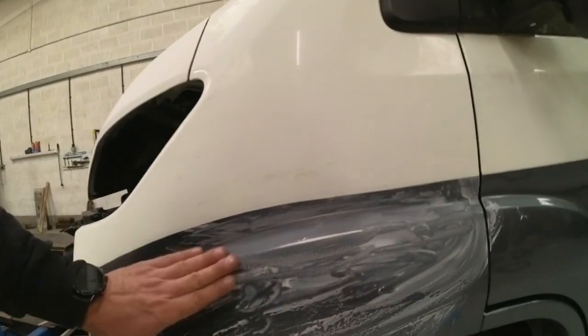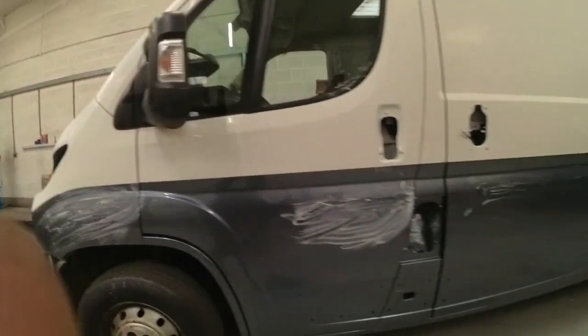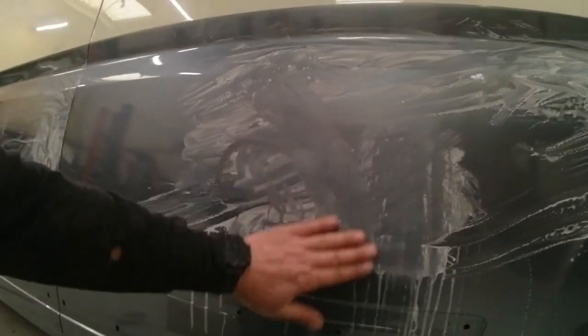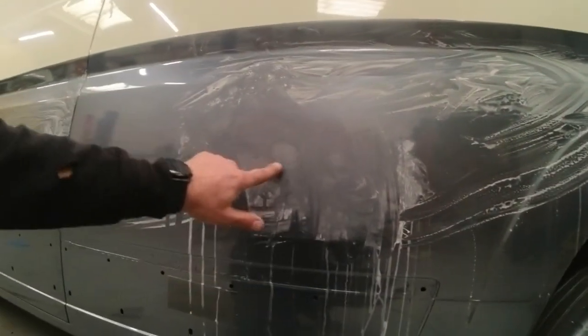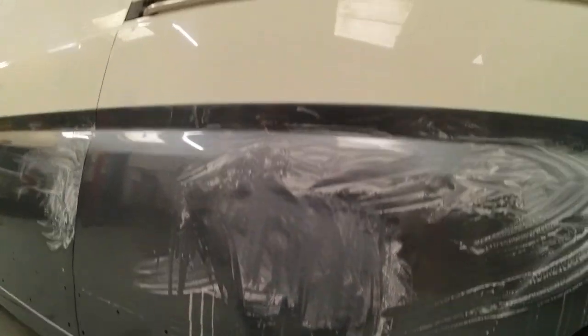All the panels are done and lacquered behind me - no runs, which was fantastic. I've had to move out the way to get some cars in so we can lock up and go home. Whilst I was waiting for that to dry I was flattening down the runs on the van and over-rubbed - I've gone through to the white, which means I've got to paint this panel again. And down here I had a really big run and I've gone through the lacquer to the base coat, so this panel has to be lacquered again. Joys of bodywork! Anyway, that's part three - stick around for part four. If you missed the other two they'll be up in the end cards so you can catch up to where we are. Take care, see you soon.